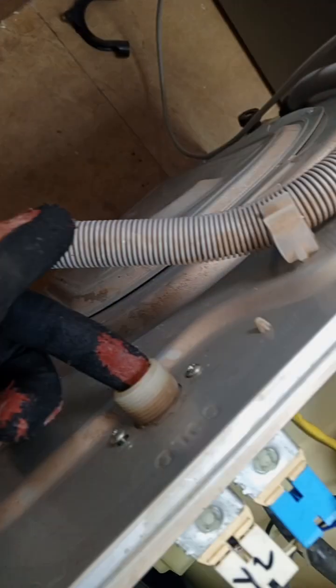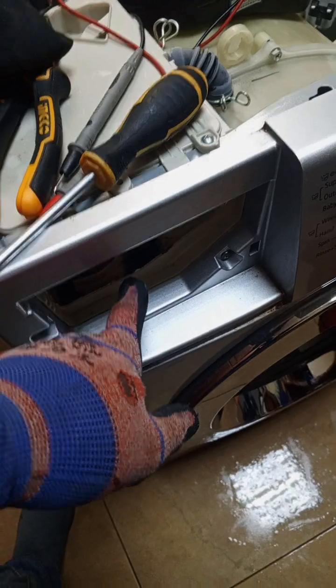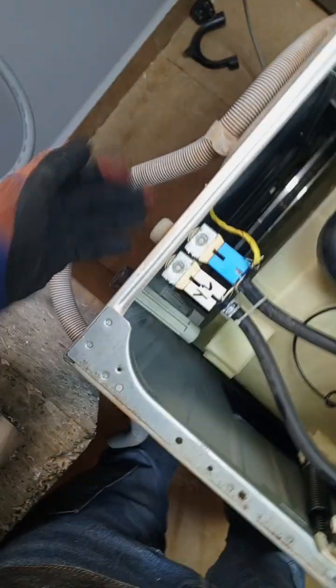Water comes from the main tap, then through the filter, through the valves, then through these two to the dispensing compartment. If it's clogged, water comes in with less pressure, so this struggles to pull in water. Now this is faulty. Let's check this using the multimeter. Quite avoidable. So before I show you that, it's easy to clean the filters.